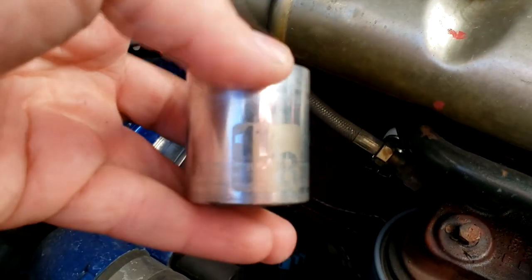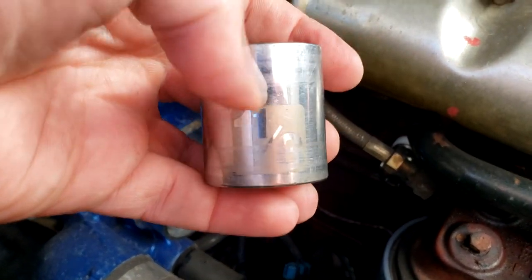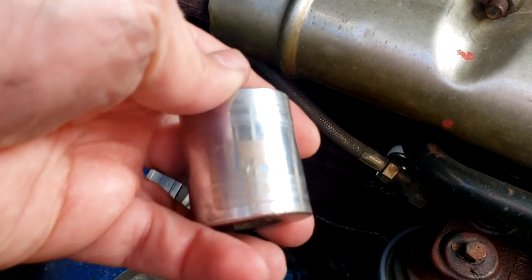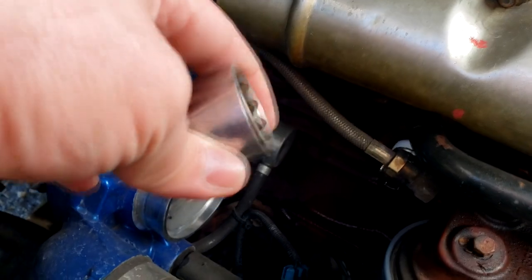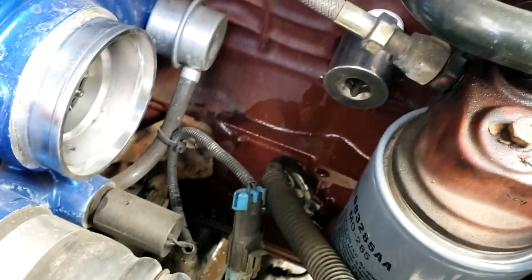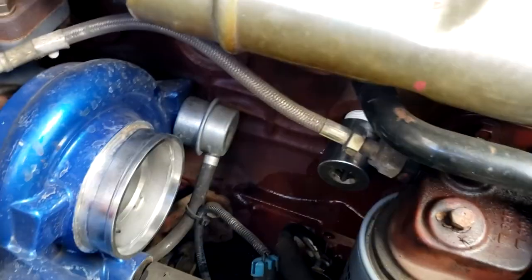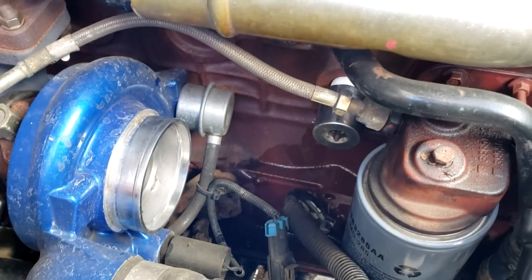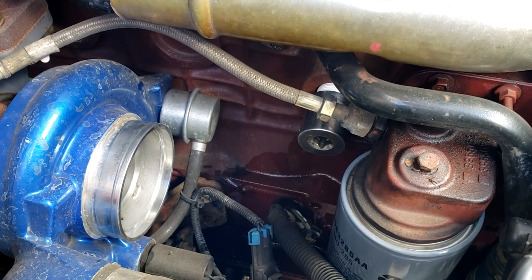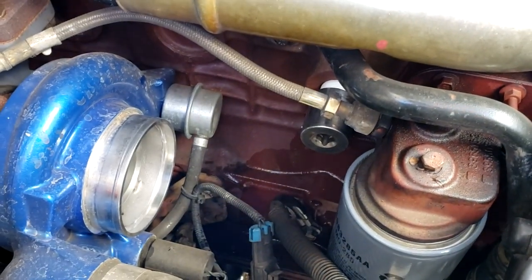Now to tighten this up, this particular kit, the size of the heater element nut is 1 1/8 inches. And that'll fit over the element. And then we'll get our ratchet and we will tighten that guy up. And pretty much nothing to it. So I'm gonna get this thing torqued down real quick and then we'll start routing the electrical cord.